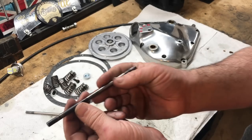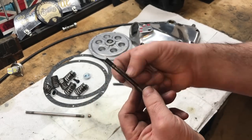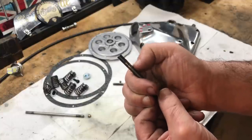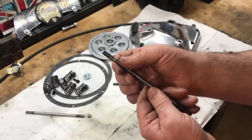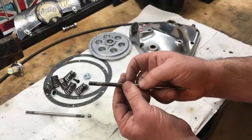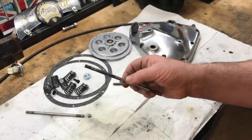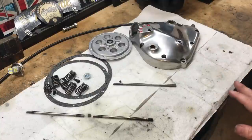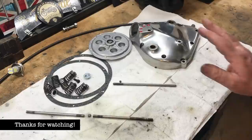And what I've found here is that there's quite a lot of corrosion on the pushrod, to the extent that you can feel that there's like a step in the hard surface of this pushrod. And I'm just wondering if that would have contributed to the poor performance of the old clutch, especially as it was moving from side to side and just wearing down with the dirt and debris inside that tube. So I've thoroughly cleaned out the tube, gone through with pipe cleaners, and it's thoroughly clean now, and so we should be ready to reinstall.